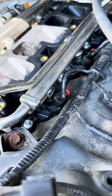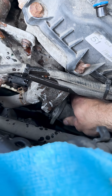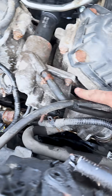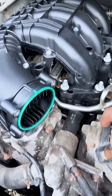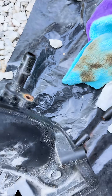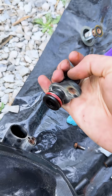The fuel rail goes right on top of it, and while I was here I also removed and replaced the engine coolant thermostat — it's a cheap part, so I thought might as well toss it in. I made sure everything was in place and the coolant hose was in place. Any o-ring I replaced, I made sure to put some silicone lubricant on it so it doesn't break during installation. It was as simple as installing all the sensors, coolant hoses, and wires back in place.